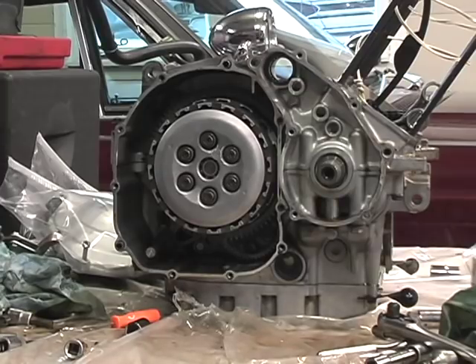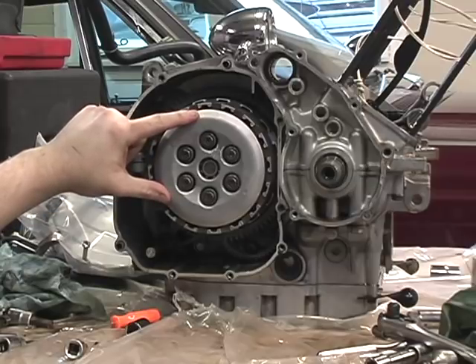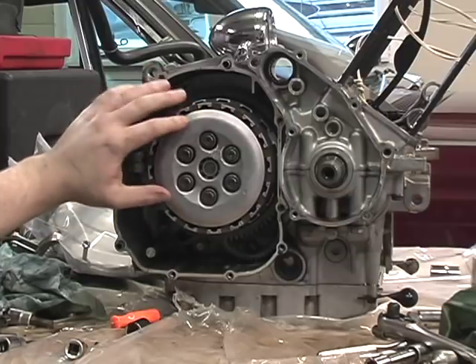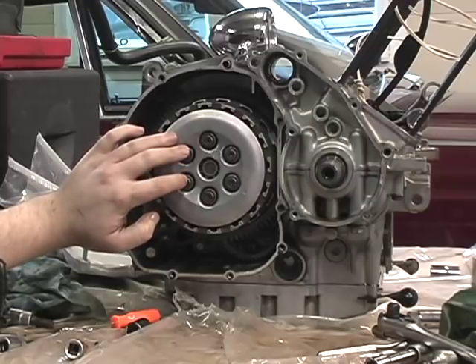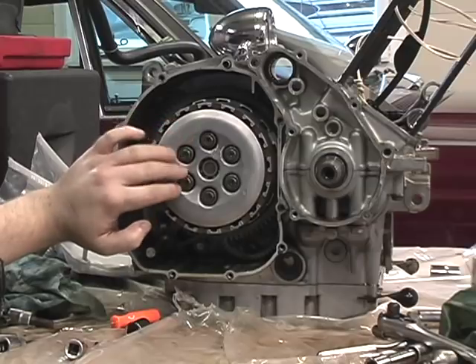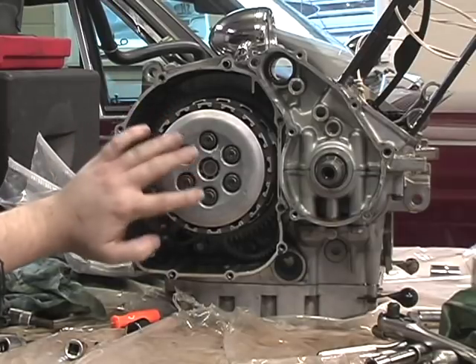Let's spend a couple of moments talking about the clutch. This is the clutch pressure plate — this is the thing that only fits one way. You've got to make sure it links up; I have photos of this meshing and not meshing. These six screws hold the springs — the springs are behind them. When you put this together, you want to use a quarter-inch drive inch-pound torque wrench or super light hand-tight, very gingerly. Don't try a 3/8 80-range torque wrench on this — it won't be accurate enough and you'll break the post. Back these off crisscross, a quarter turn at a time until the spring tension is off, as evenly as you can.